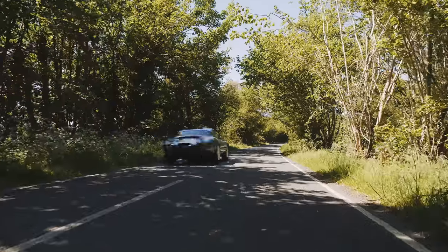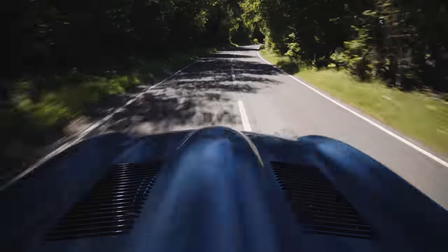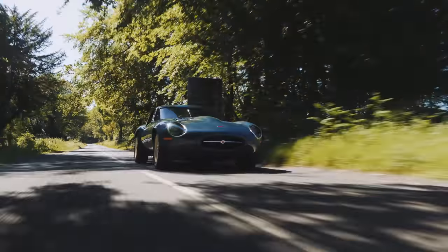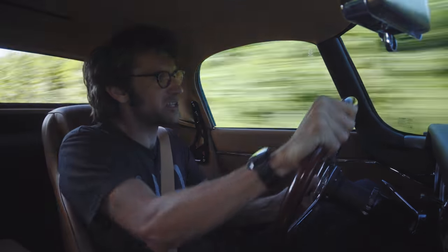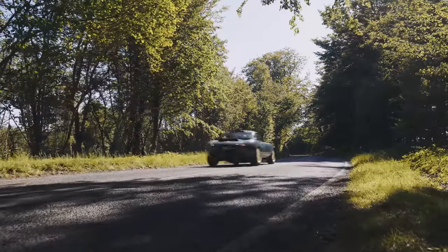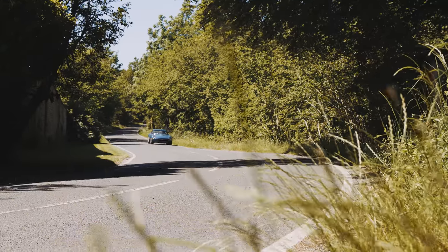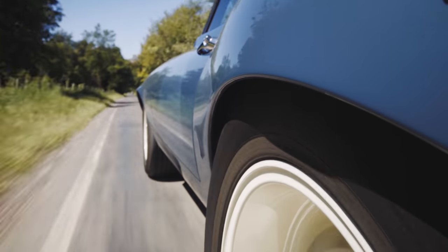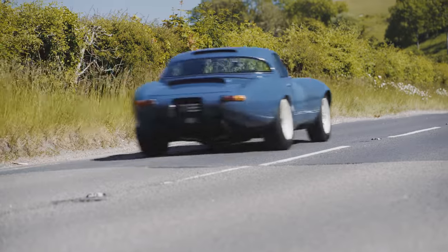That long bonnet does feel like it needs to be fed into the corners. It feels like a really quite a big car because of that long bonnet out in front of you. In fact, it's tiny, really - just because it's so low and so long, it looks bigger than it is. The original geometry on the E-Type was designed around cross-ply tyres, and they stuck with that geometry, so they didn't ever make the most of new radial tyres - that was one of the things Eagle addressed early on. This has got Ohlins dampers, and they are fantastic. The ride is quite busy at low speeds, and then it gets into a state at a certain speed where you feel it breathes with the road much more. You feel it get into that happy place.